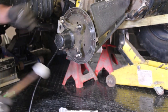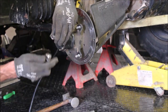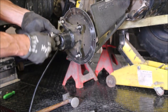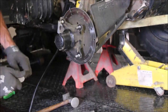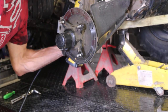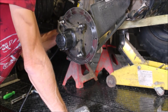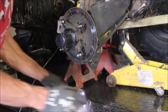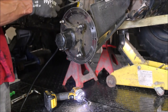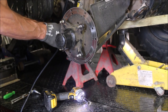It appears the customer may have stripped these out, so I'm going to have to try to make this work — hopefully without damaging the tool. To resolve any of that, I'm going to take the brake caliper off and make sure that's not hanging up. Look at that — the Hall effect sensor is broken off, which means the speedometer doesn't work. I do have new brake pads, so that'll be something I'll put on.